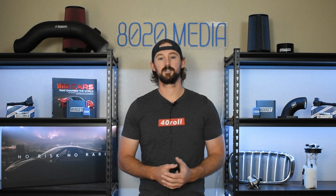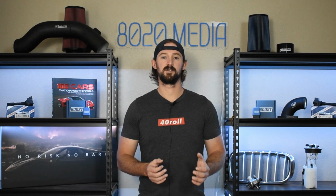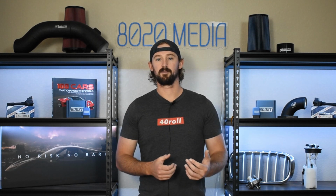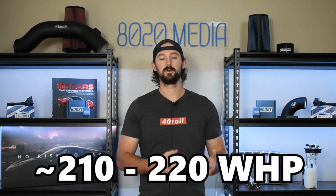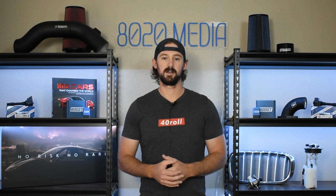So in this video, we're going to talk about the bolt-on modifications that can take this Subaru BRZ and its 2-liter naturally aspirated engine and add approximately 50 wheel horsepower. The drivetrain losses are real on these engines, with a stock BRZ dynoing around 160 to 170 wheel horsepower. So with these modifications, we'll be able to take the BRZ to about 210 to 220 wheel horsepower with 5 simple modifications that are going to run you around $2,000.